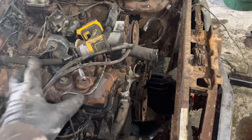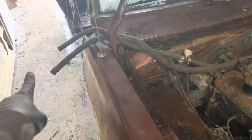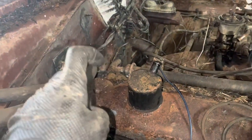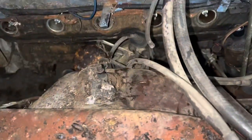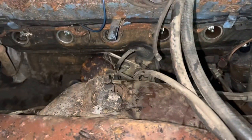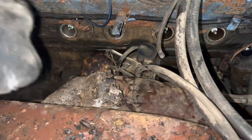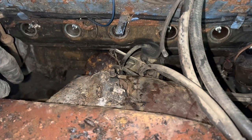Generally when I am putting an engine back in, I just pop the heater hoses off and flop them out of the way behind the hinge. This especially applies to small-block V8s because it's back there right in the line of fire. I do like to pull the distributor caps with the wires just to get them out of the way and make sure the caps don't get broken. On a slant six it's really easy to do this — just mark where number one is so you'll know later.